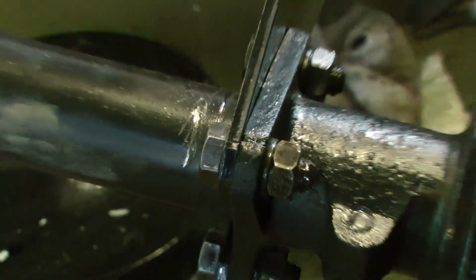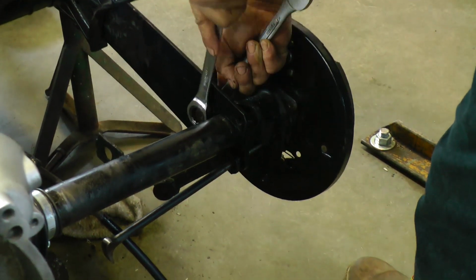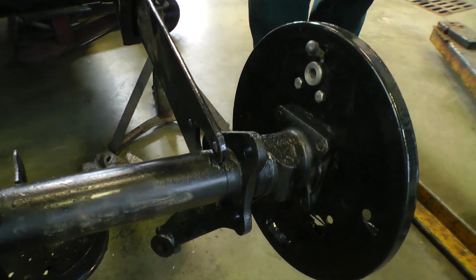You're going to want to loosen those nuts and bolts, and also chisel a mark, as you can see there, on the top bolt, so when it comes time to put this all back together, you can line it up correctly in the end. So like I said, just take the bolts off. Make sure you also undo your shocks and undo your steel and soft brake lines.